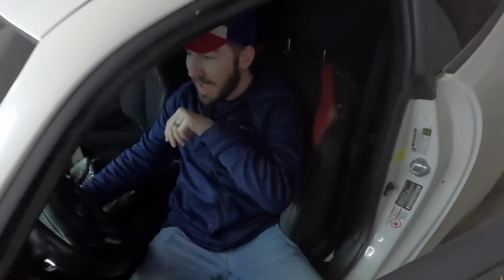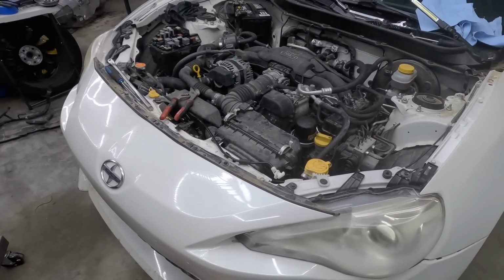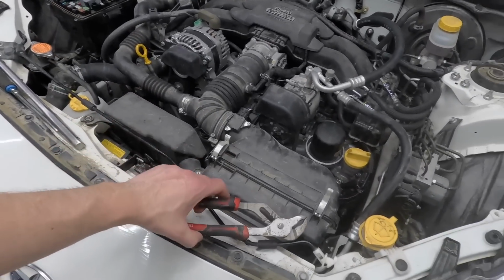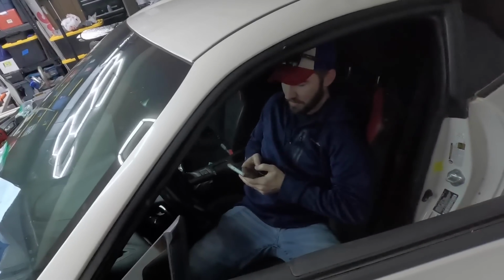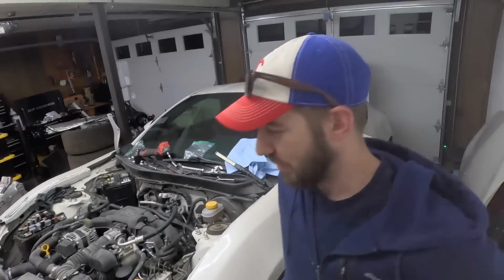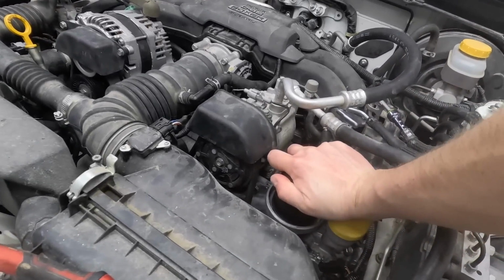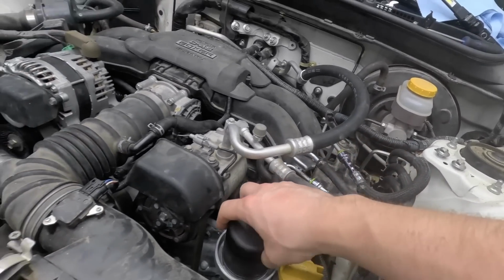I was just kind of worried about this engine that we just put in. What do you think? Just because it's making a noise when we turn it. Fuel pump relay's out. I'm gonna try to crank it and see what happens. Sounds like the phasers, because they're both clicking. We found out that these things have like 10 psi of oil pressure at idle when they're warm. It's like 40, I think, when we started it. We could see if any oil got to the filter yet, but I really doubt it. Yeah, nothing to the filter yet.